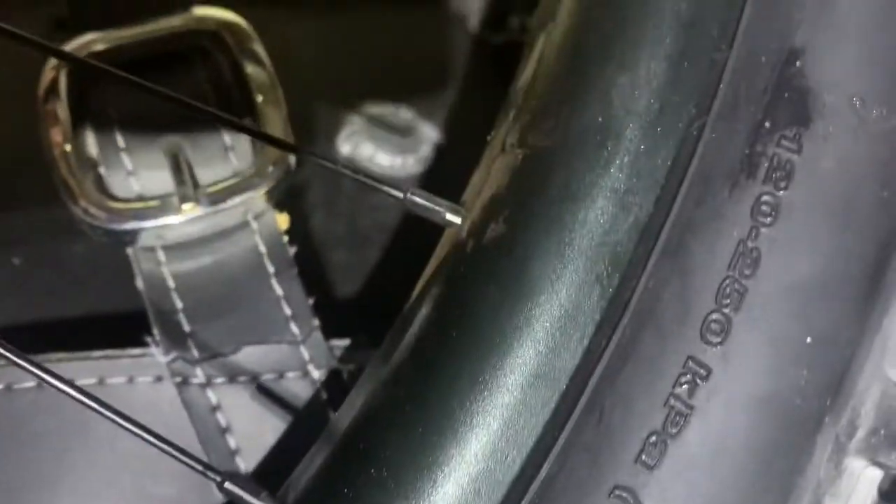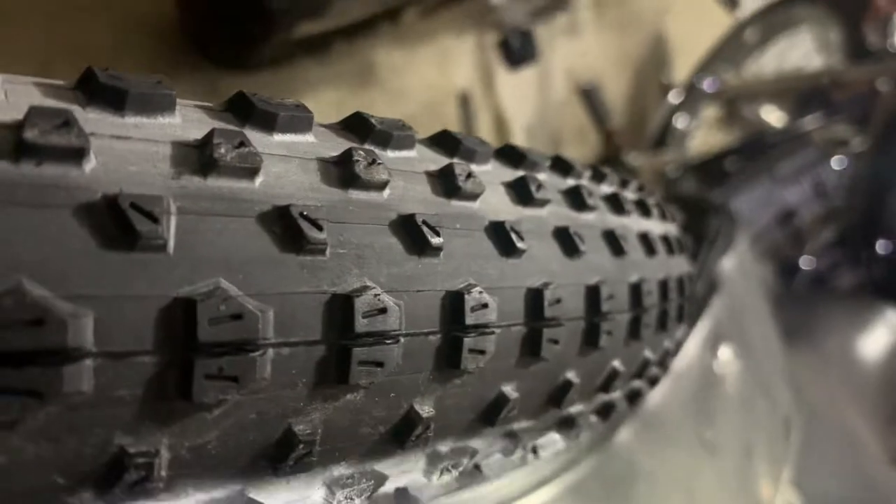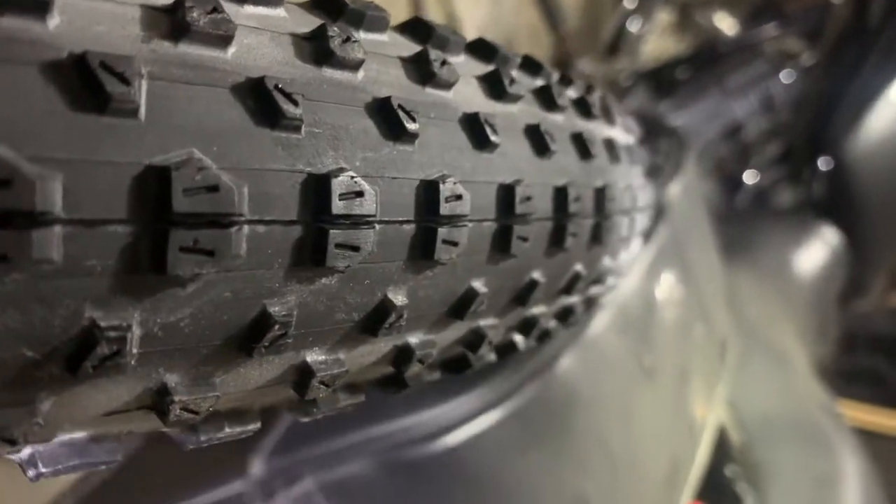What you also do is look at that little line on the tire — most tires have that. You're going to use that as an estimate of where the tire may not be fully pushed out, fully seated. On this one, it looks like it's probably pretty even all the way around. But sometimes it won't fully pop out. When you look at the tire or put it on the bike and roll it, one side of the tire will be kind of pushed down.